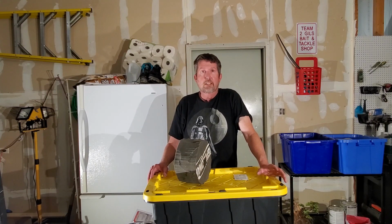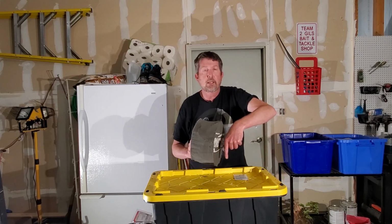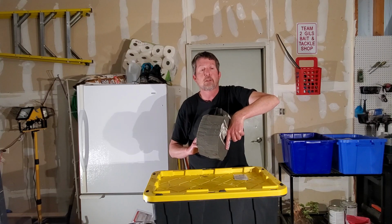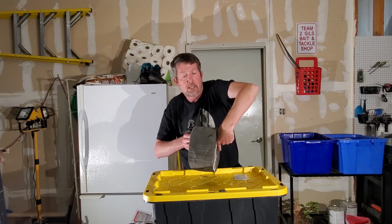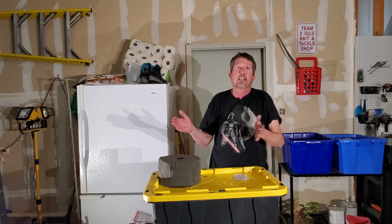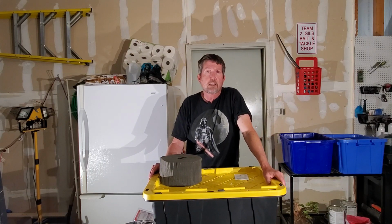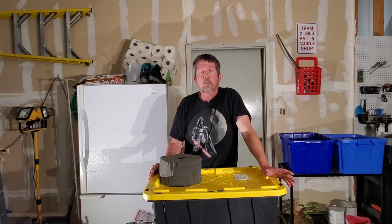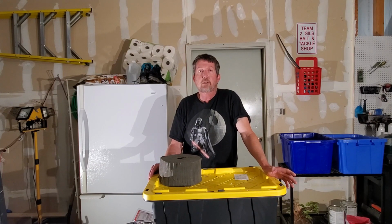If you're doing a lot of really tight woods racing, which I am, you want negative caster, and so that's bringing the top of the spindle forward like this. Instead of this up and down, you're going to be pointing down at the ground. That's going to give you a lot faster steering. It's going to allow you to get in and out of the trees a lot quicker, but you're going to suffer some high-speed stability. So I don't do a lot of high speed. It's generally short distances when I do.